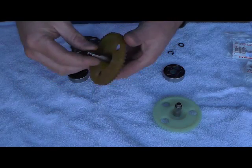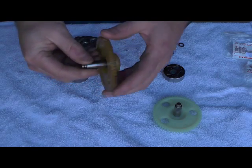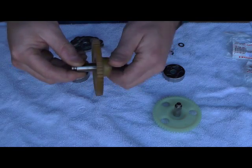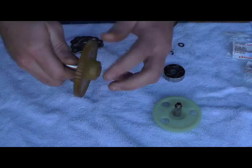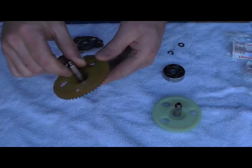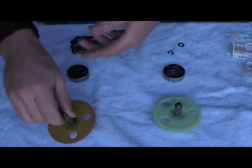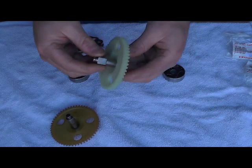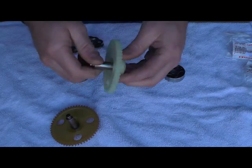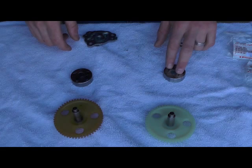When I got it apart, everything looked pretty good besides this. I didn't see how the pump could turn with this loose like that — it almost feels factory, like it's supposed to be that way. But I took it to the expert in town and he said yeah, that's broke. This is keyed, so there shouldn't be any play in it. As you can see, the new one is locked solid — there's no turning to it. So I elected to go ahead and get the new pump also.